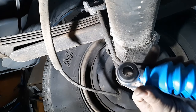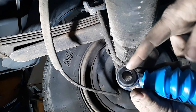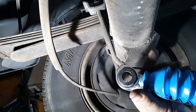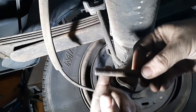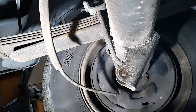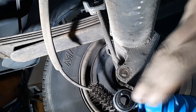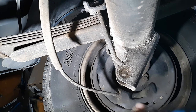One of the first things you want to do is get some type of lubricant and lube up these holes. It's best if you don't use a petroleum-based lubricant just because those tend to be kind of hard on rubbers. So if you had a silicone lubricant, that'd probably be the best. Also, you want to make sure you clean up these bolts — the cleaner these are, the easier it'll be. Same thing with the stud at the top. If it's got a lot of caked-on rubber on it, hit that with a wire brush to knock some of that off because it'll make your life a lot easier trying to get the rubber grommet bushing over the stud. When adding a lubricant, I like to put it on both the grommet itself and the stud — that way both ends are lubricated.